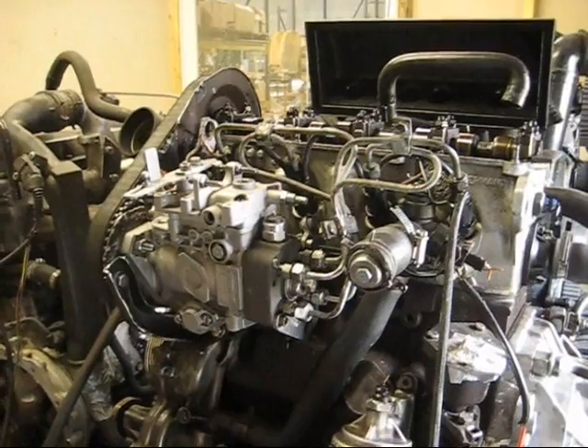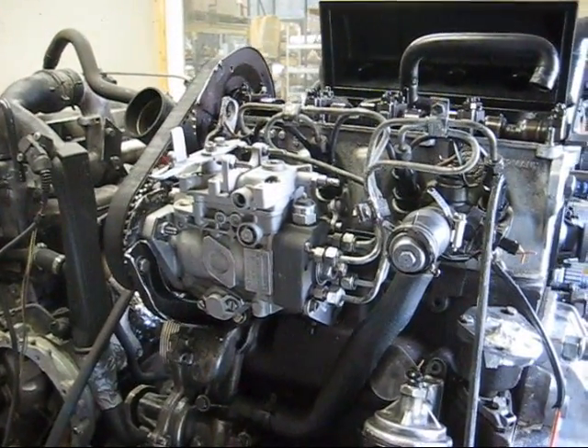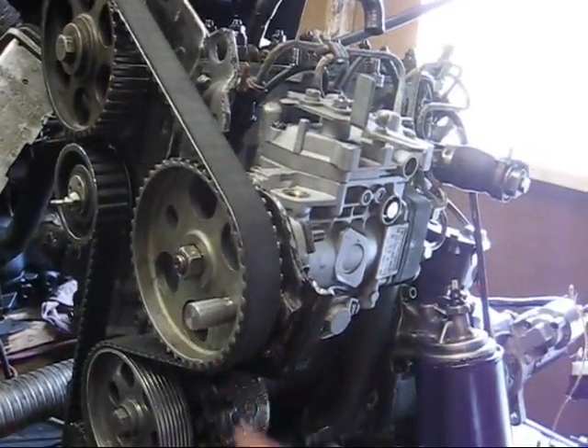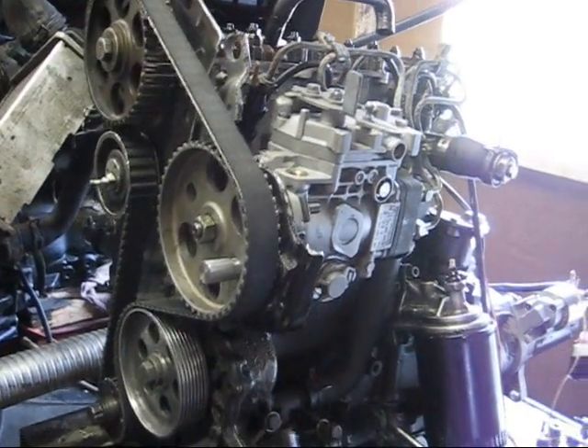You'll move on and put your locking pin into the injection pump through the injection pump sprocket into the mounting bracket, which is located here. Once all those things are done, you can loop the timing belt through in tension.